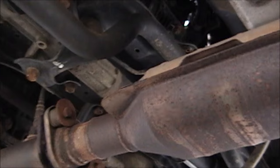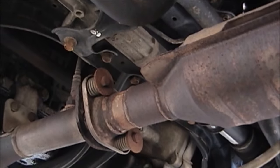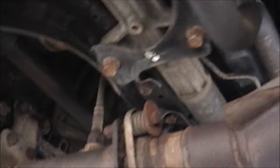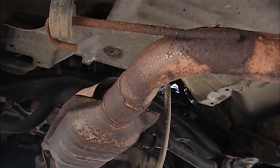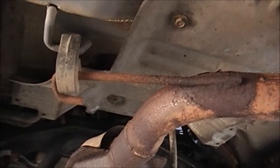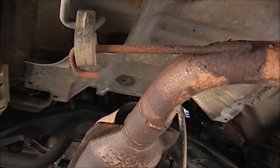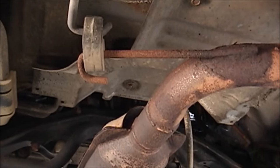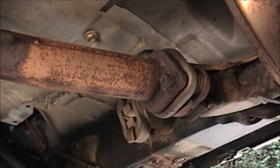They really didn't do a great job. They welded a piece of the original cat off and welded on a new cheap cat. They used red RTV to hold the front connector together, which has since come out, so it's leaking right there at that joint. The pipe between the catalytic converter and the muffler is bolted on, but in a factory car there's supposed to be a three-bolt connection. What they really did is just weld a cat in there and replace one piece of pipe that was leaking — basically no parts, just charging a lot of labor for making up a set of pipes.